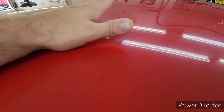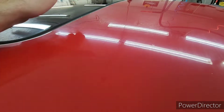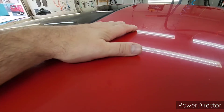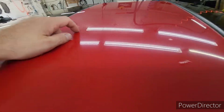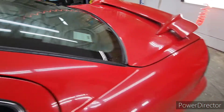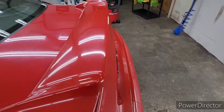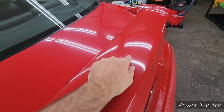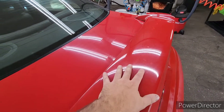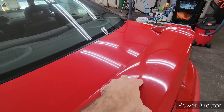You could compound on this all day and would never get the results of clear coat restoration. By actually adding clear coat, versus compounding where we would actually take clear coat off — and you'd have to take a lot off, which I do not like to do. You can see this is starting to pit and it's getting thin. Usually they don't put as much clear coat on these, plus it's plastic fiberglass, so it fails first.